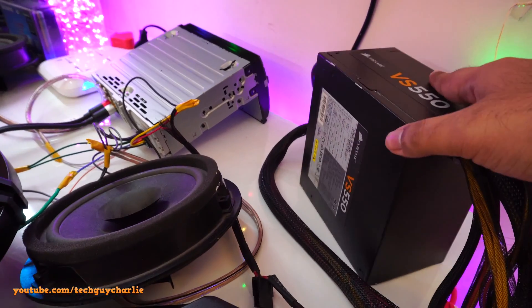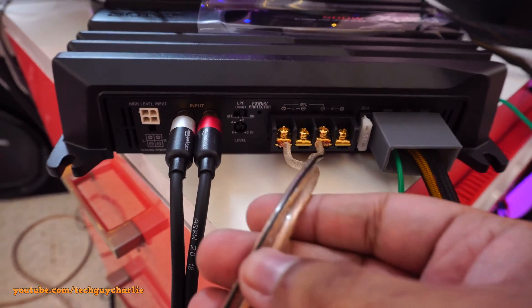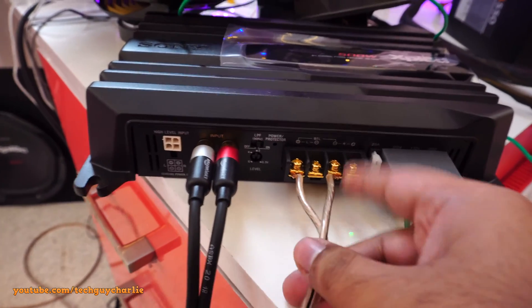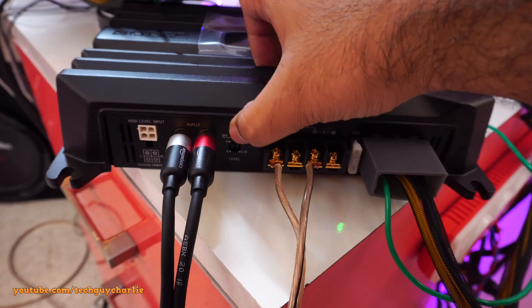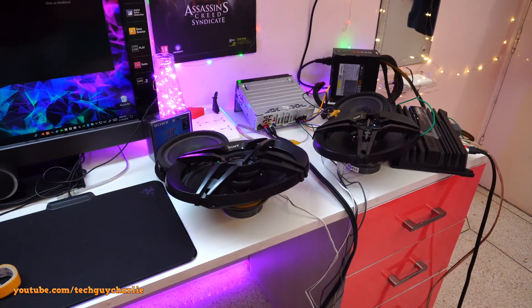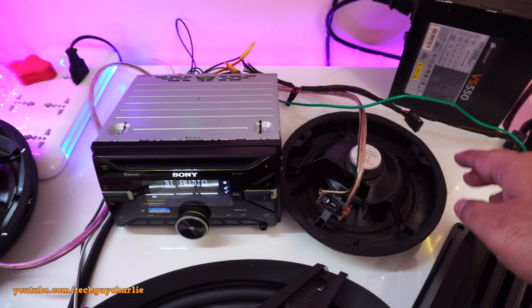The amp just turned off with the head unit — so you don't have to worry about the amp itself. The power supply also has a button you can switch off if you like. This 550-watt power supply is quite capable of driving the whole setup. For the subwoofer wiring, we've wired this up in bridge mode to use the full capacity of the amp to drive the subwoofer. The wire with the black stripe is used as negative and the other as positive. Make sure the low pass filter is turned on since we're driving a subwoofer, and the RCA line input connects to the subwoofer output on the car radio.